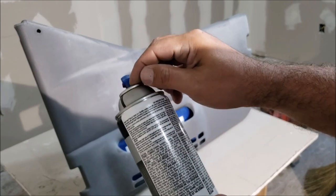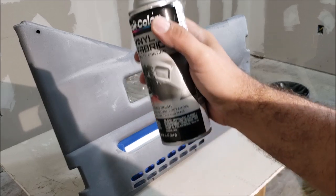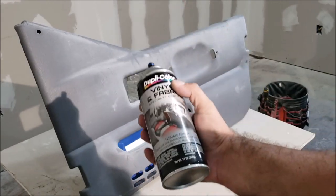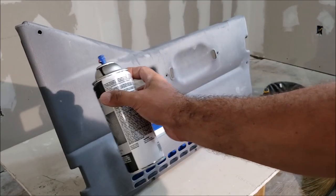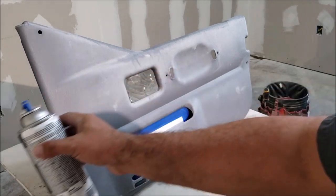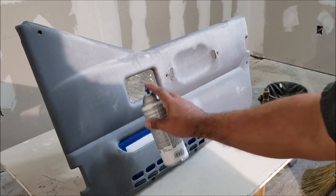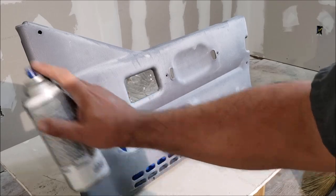Start shaking your can — these things like to spurt and squirt. I was actually spraying with this one and it just started spraying straight out the top, so be very careful. If it starts spraying all crazy, stop, clean it off, and let the paint warm up — shake it for about five minutes. To do a good job, you've got to understand how to spray. Practice on the back side. Keep it six to eight inches away at a consistent distance and do not stop while spraying — go all the way to the end. If you stop in the middle, you can get a dry spot and it'll look like crap.